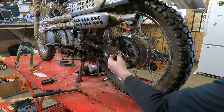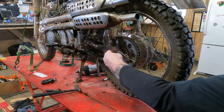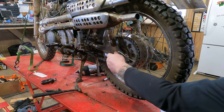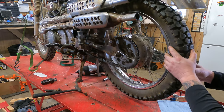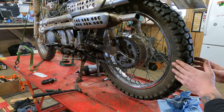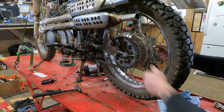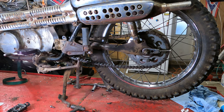Next, slide your washer on there and slide your castle nut on. You can run this in until it's snug and then back it off a wee little bit. Don't tighten up yet, because we have to align the chain and set the chain tension first. But at that point everything is reinstalled. Give it a good visual — make sure your spacers are on the appropriate side, make sure you didn't forget to put an axle adjuster in there. Just give it all a good once-over before you start going any further.